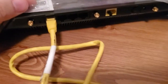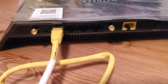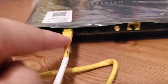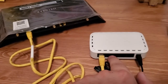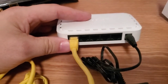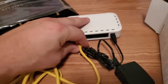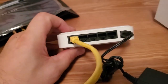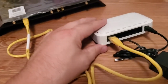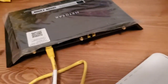When you plug a cable from the router into the switch, you're taking away one port from the router. So depending on how many wired devices you need — one port is dedicated to the switch, leaving you three on the router. And then you have four available on the switch, giving you seven total. So if you need more than seven ports, you might want to buy two switches or a bigger one — you can get eight or ten port switches. Don't think this five-port switch is your only option.